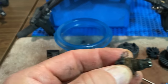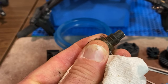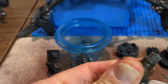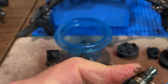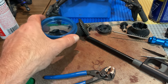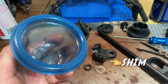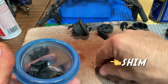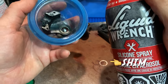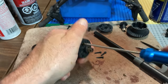The backside, the gear side of the yoke, will come off — nothing special to note there, no tab on that side. Here's the input gear — this did not go well for me. A handy trick I saw online from the Facebook Arrma group: put the gear in the freezer before removing the bearing. It's a great idea because I grenaded this bearing and had to buy two new ones. To clean up, I put a little rubbing alcohol, then spray the bearing pieces with silicone spray and let them sit for about 10 minutes so they get nice and lubricated.